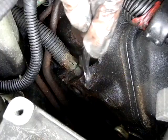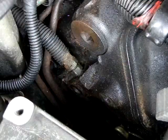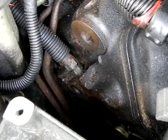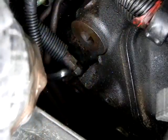Here right behind the air conditioner, we have a return fuel line fitting and the hose. Now, I'm actually going to put new hose on this like I did on my first truck. So what you do is you just take these off. This is a 9/16 inch. It's really a good idea just to replace these and not reuse them.